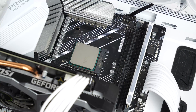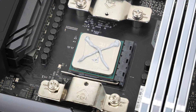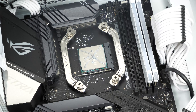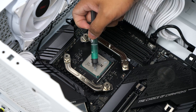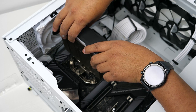If you're reusing your cooler, you'll need to apply some new thermal paste onto your CPU. If you have a new CPU cooler with pre-applied thermal paste, you don't need to add any. Make sure to only apply a small amount — the purpose of thermal compound is to ensure good contact between your CPU and the heat sink. The most common method is the dot method, where you place a small amount at the center of your CPU and it spreads when the heat sink is seated. My personal favorite is the X method, where I make an X with the compound. Run a test on a piece of paper first to get a feel for the pressure needed, so you don't accidentally apply too much and cause it to spill over the sides when the cooler is installed.